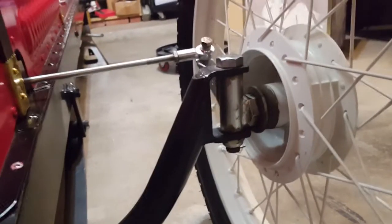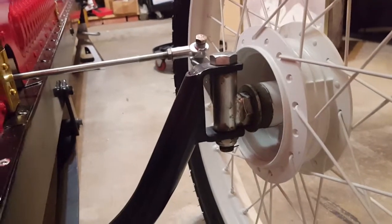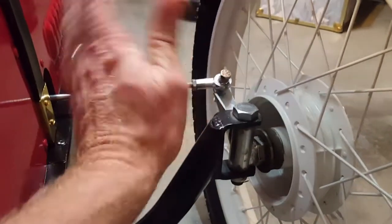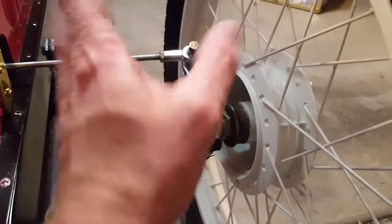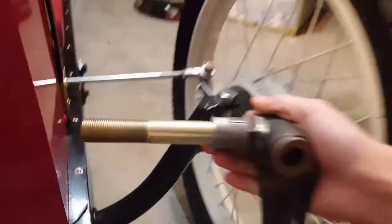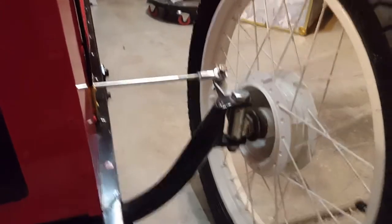There's no bushing in here — it's just a bolt through a pipe, basically. I did put some brass bushings in there but they only lasted about six months and got really loose — they probably decomposed and got crushed. This replacement is a direct drop-in at the exact same bolt position, so I won't have to touch the tie rod or affect my alignment. The new spindle goes in the same position, so I just need to unbolt this bolt and put the new one on.